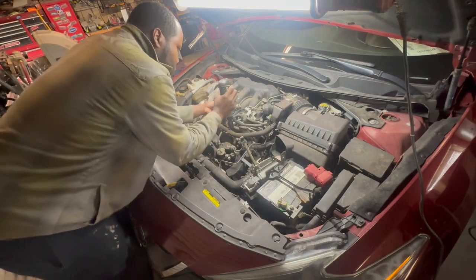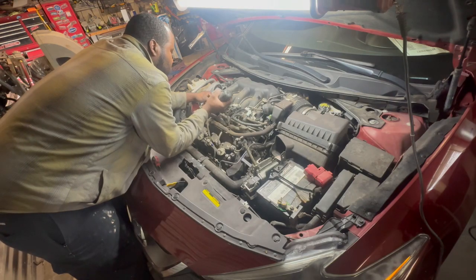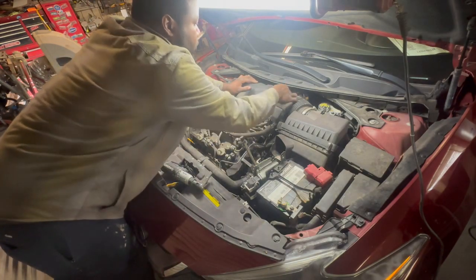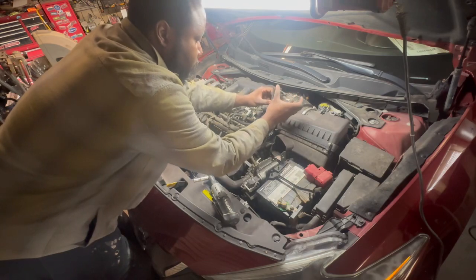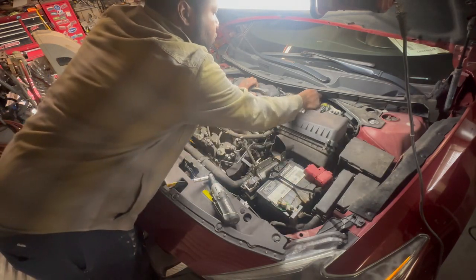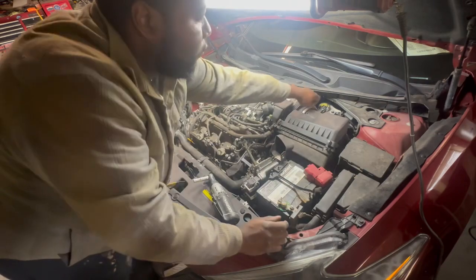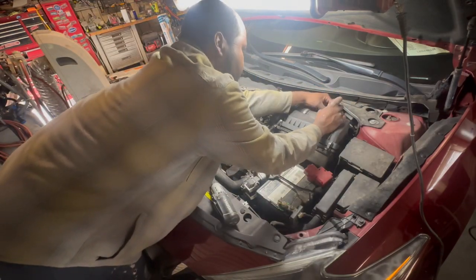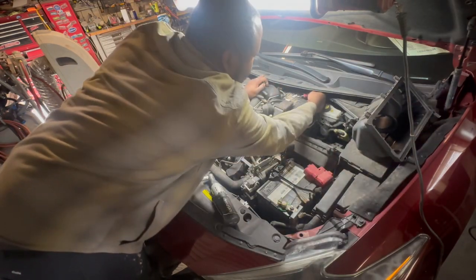This job is not difficult. What I'm doing is there's a row of 10s on the front of this intake manifold — they deal more with the vacuum lines. All I'm doing is loosening those brackets up so I can lay them to the side. Sometimes those vacuum hoses don't want to come off, so you take pliers and twist back and forth. I have at some point taken a little lighter and kind of put that around the hose, just enough to loosen it up so you can pull it off. Now I'm going ahead and taking off the air box where the air filter is at, and that little intake tube — just take it off the throttle body.